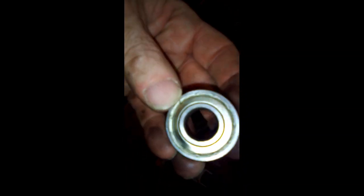You know, I was just looking at this pilot bearing over. I do realize there's something crazy on that. Does that look like it's bent? Hammered in or something? That does not look right. The other side does. This side's got something going on with it. So I think I will replace the pilot bearing after all. Not sure what that is, but it's definitely damaged. Okay, new pilot bearing.